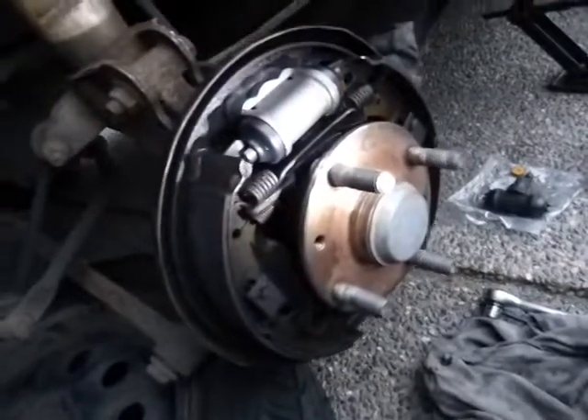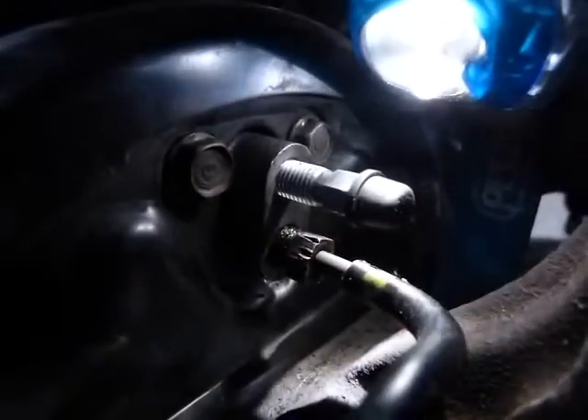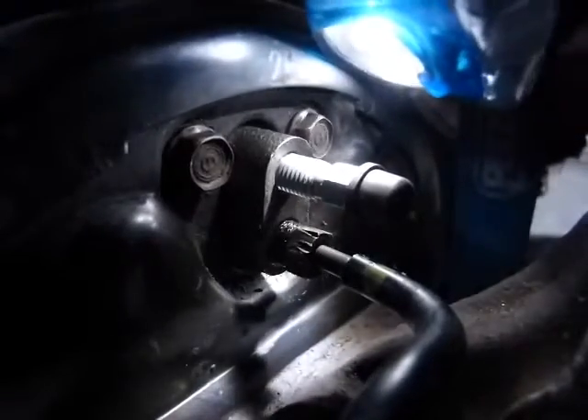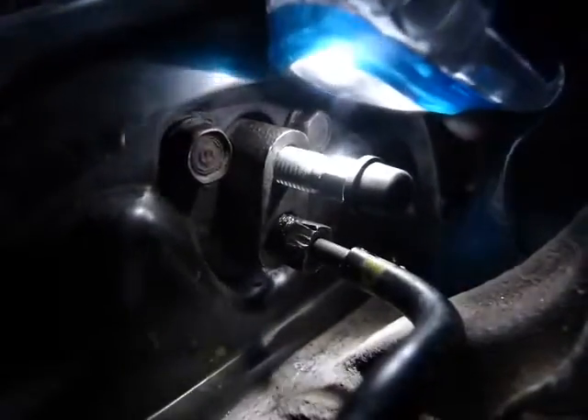Bleeding the brake through the valve — I'll show you. Take a last look. That's how the tightened bolts look from the backside. The brake line is connected. It's not dripping anymore. And now indeed both of these 10mm bolts are tightened. So that's the rear view too.